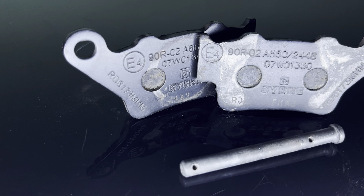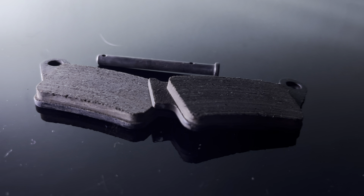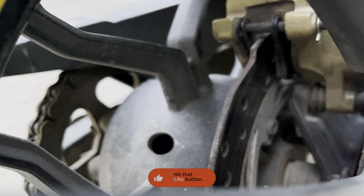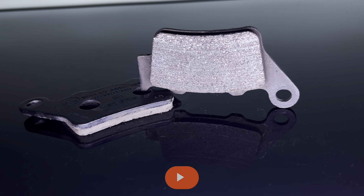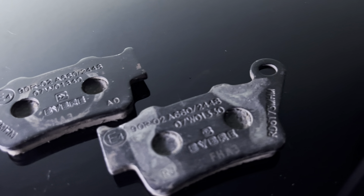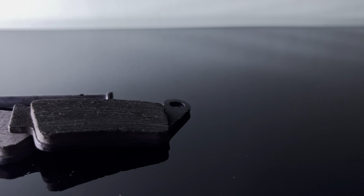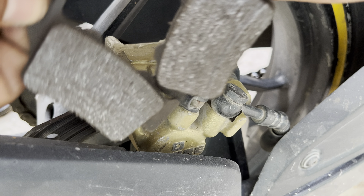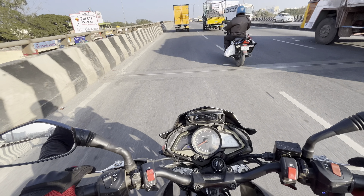At the other end of the spectrum, organic brake pads are one of the cheapest options, with minimal brake dust compared to the other two. They produce less heat and are silent in operation, and the best part is they don't harm the brake rotor. However, when it comes to actual feel and feedback, organic brake pads are the least powerful. Being made of softer materials, they don't last as long and tend to drop in performance once they warm up. When organic brake pads come in contact with water during operation, the surface can get polished and become smooth, requiring you to remove, sand, and reuse the pad to regain performance. Periodic maintenance is a must with organic brake pads.